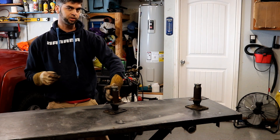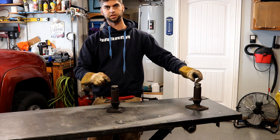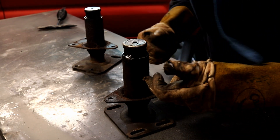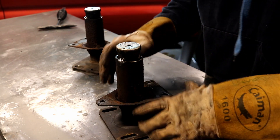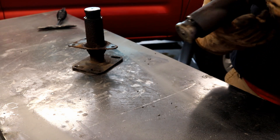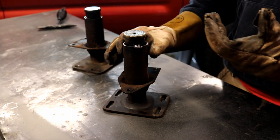What we're going to do is weld these up the rest of the way. I'll show you exactly what the plan is after I get the second tack on the back side on the pistons. Our next step is to drill a hole all the way through the casing and slide in some old bolts — make a shear pin situation — and then weld that to the casing. So in the event this thing ever gets rear-ended, I'll still have at least an inch of play, but there'll be a little resistance. The force is going to have to exceed whatever that PSI is to break the shear.